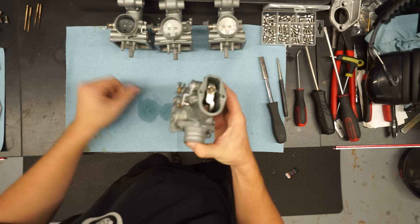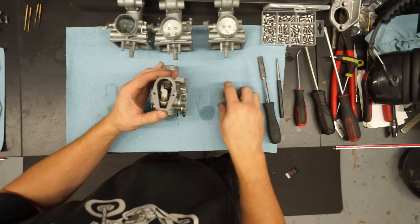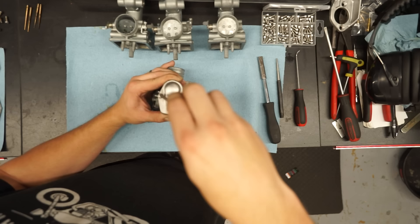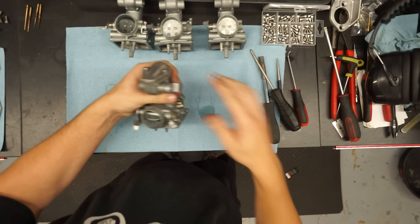The slide is installed and ready to go. Next, put the new gasket on the top cap — I've hit the cap screws on the wire wheel to clean them up. You can replace these with socket head allens or stainless if you want to dress it up a bit. Don't overtighten — just a nice snug fit. The top of this carburetor is done.